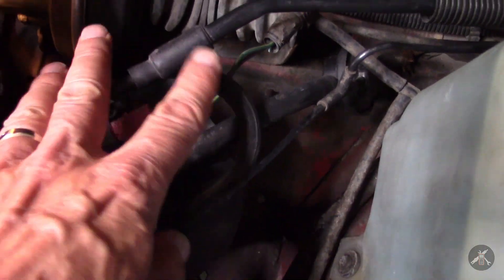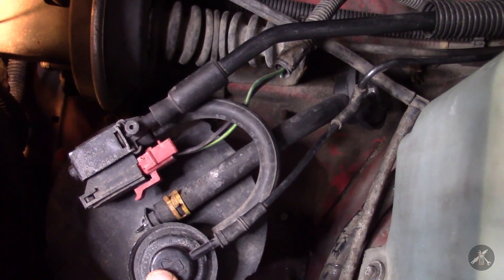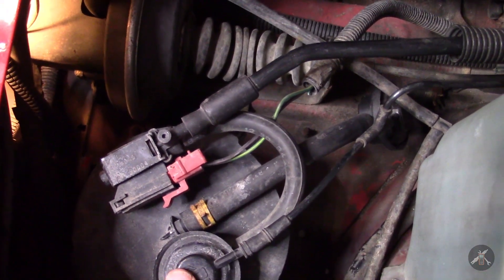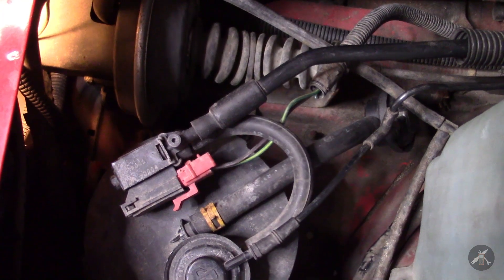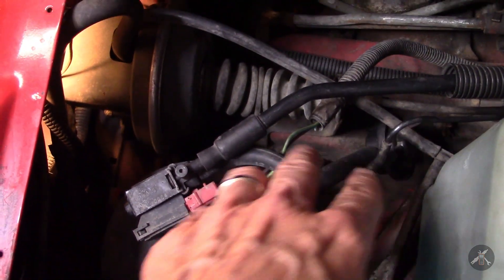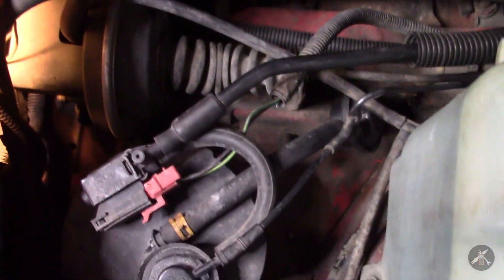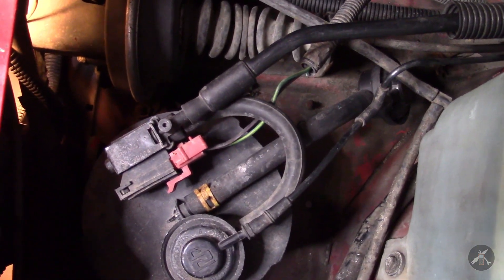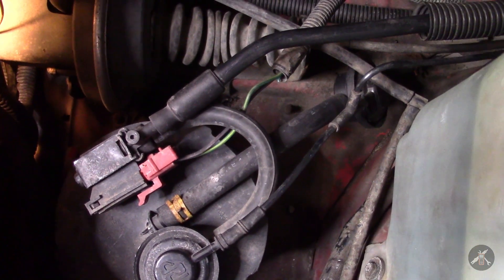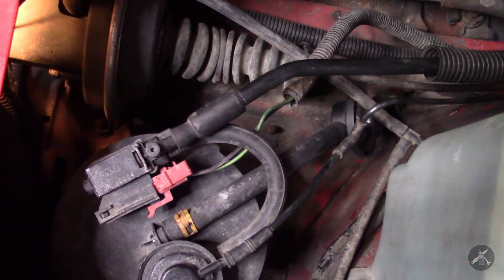In different years the configuration may be different — this is my '85. If you have a throttle body car it may be a little different. These are ECM-controlled. A lot of the carbureted cars are not ECM-controlled and have a simpler canister with just a couple of hoses, and a separate mechanical valve that does the same type of work — just with mechanical means, and probably isn't as precise because you don't have a computer controlling it.